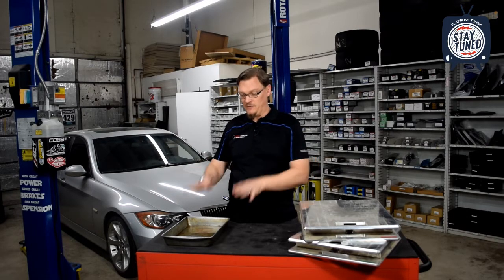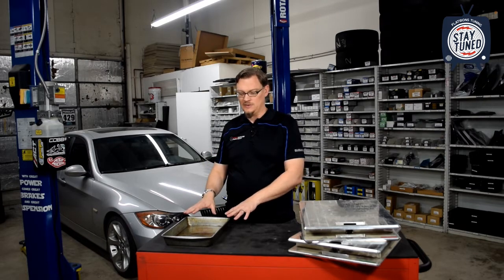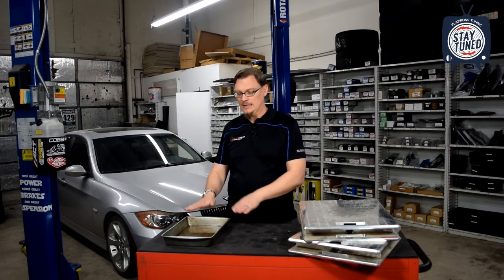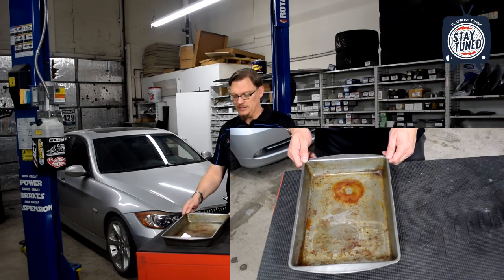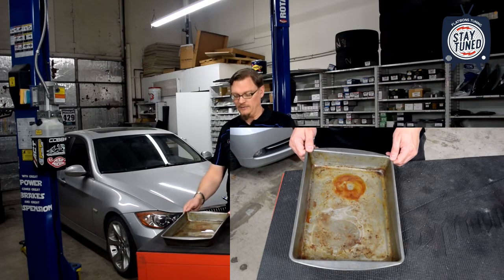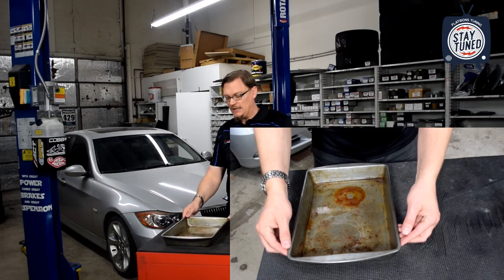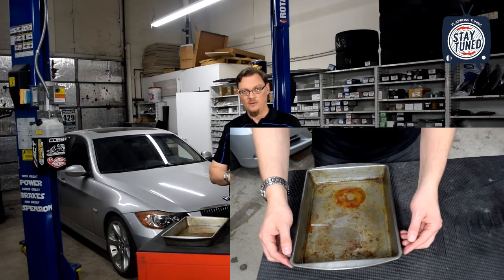That was a really good example of how ride height affects the weight distribution of the car. And that's why I've got this pan here in front of me. One of our aha moments is we realized that as you're setting ride height and corner balancing, a good visual to keep in mind is a pan with just a little bit of water in it. If you pull up one end, the water slides to the front. If you drop one corner, all the water goes to that corner. That's how changing the ride height affects the weight distribution of the car.